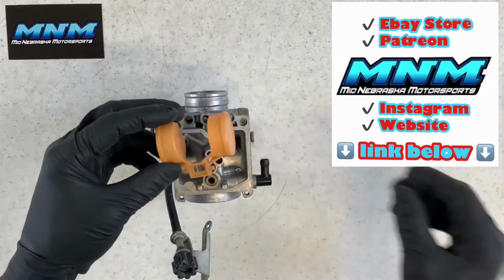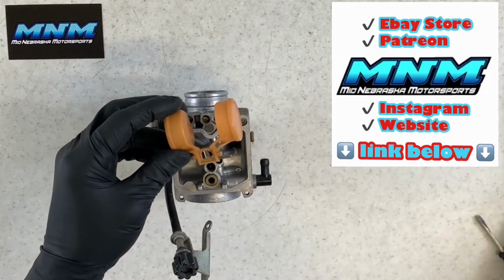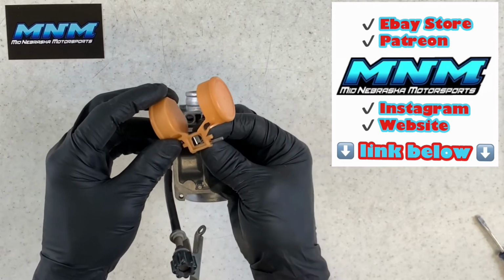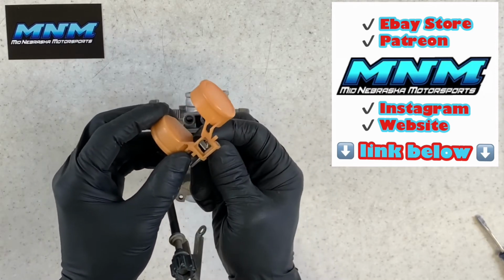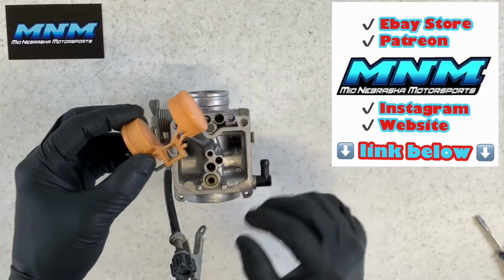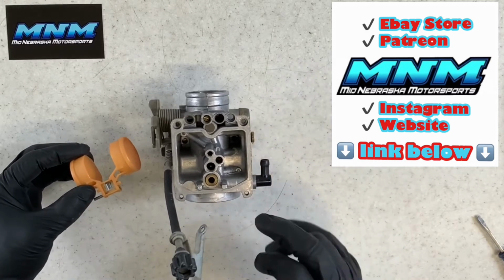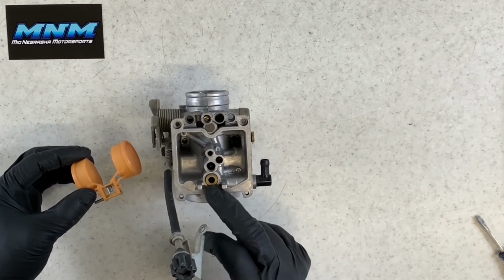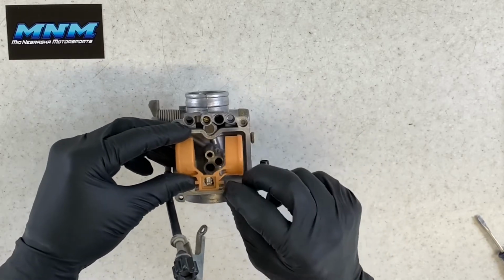Now we're going to take our float here. We're going to take our pin that runs through there, and we're going to take our needle here. It doesn't matter which direction that goes on there. Slide it into place. Again, make sure that that seat area is cleaned out completely. The fuel coming from your fuel tank comes in this port here, runs down this line here, and comes out of this valve here. So you want to make sure that you take compressed air, blow through there really good.